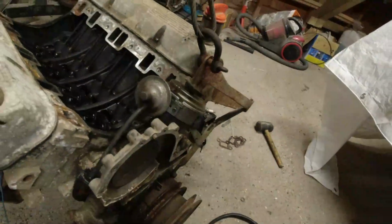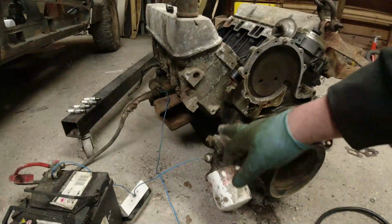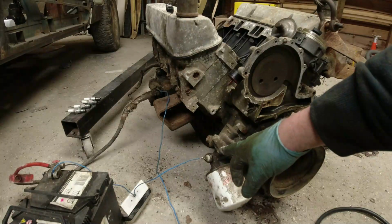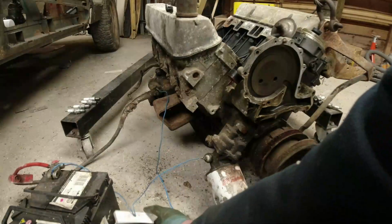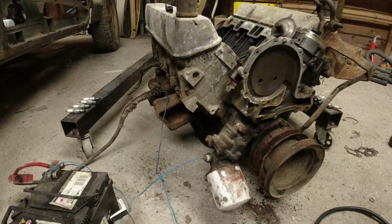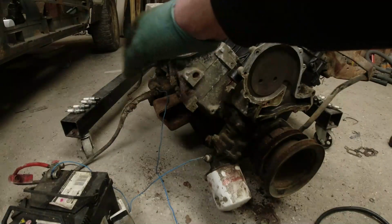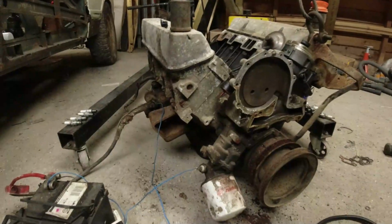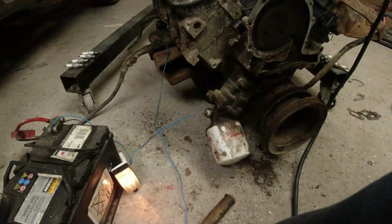Fortunately, my big box of diagnostic kit is one of the very few things that didn't actually make it into the container. So we're going to work on an oil pressure valve. We're just going to hope it works. I've hooked it up to this light down here, so if the light goes off, we know that we're getting some oil pressure. So all I've done really, hooked up the positive wire from the back of the starter solenoid to a battery positive. Jump me, go from negative. That'll go to the top of the engine. Oh look, there's the light on. And then I've got a little jump lead here going to the starter solenoid, which I shall put on here and it should crank over.